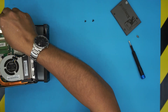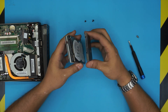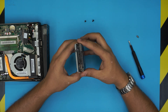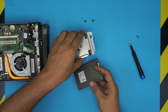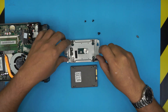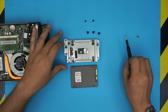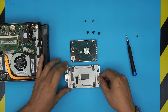Now we have the hard drive mounted on a caddy. Put the PC to one side and position the hard drive the same way — make sure the SATA connectors match so you don't put it in the other way around. Even if you try, it won't go because the screw holes are at the bottom. Remove the four screws and the hard drive should come out easily. There's a missing screw on this one — someone opened it already — so try not to lose the screws.